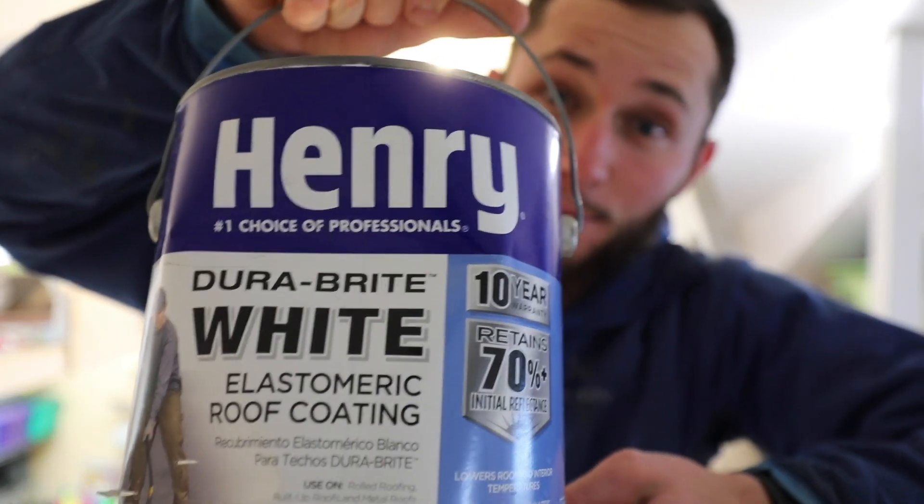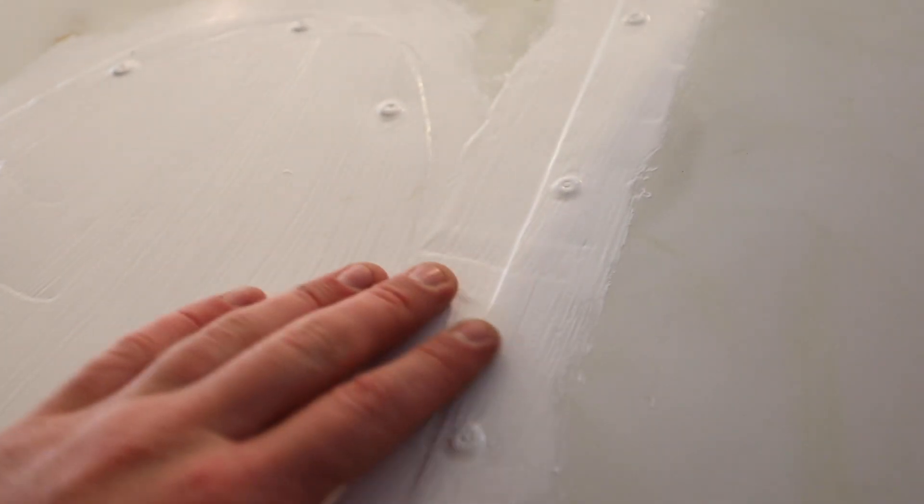Today is an exciting day because we're finally going to do something that's going to make this bus look better — painting the roof. I have a big can of Henry's elastomeric roofing paint, which is going to paint on a layer that hardens into a big solid glove, essentially a plastic glove that goes over everything. I've already done a layer of Flex Seal seam sealant — a rubber-based plastic paint — and I think the more layers I do on the seams, the more water protection I'll have. Right now we're testing how Henry's behaves on top of the seam sealer before moving to the visible sides and face of the bus.